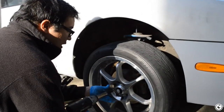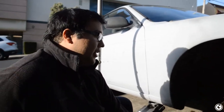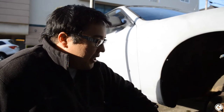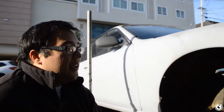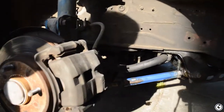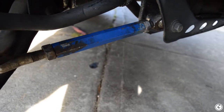The brakes are also warped — it doesn't feel good when you brake. I bought a five-lug swap from 240sx-convergence.com for 190 dollars shipped, no tax, which is great since everyone locally wants 250 to 300 for used ones two hours away. The only issue is they're back-ordered until mid-May, but that lines up with the build date anyway. As for the seized tension rod — notice how there's like three times more thread showing on one side vs the other — we couldn't do anything about it so we're replacing it.